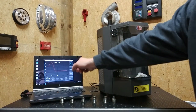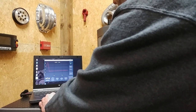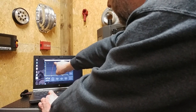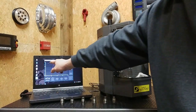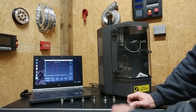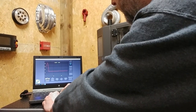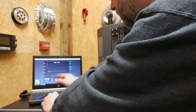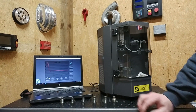So this is what happens. You can see the pressure — once it jumped up — we can stop the scope and zoom in. We can see that about 210, and this is 212, so between 210 and 212 MPa, when the pressure spiked up, we can see that the valve opened up. In just a split second, the pressure gets down here to about 60 or so — it says 72 here. So we're maintaining 72 MPa.